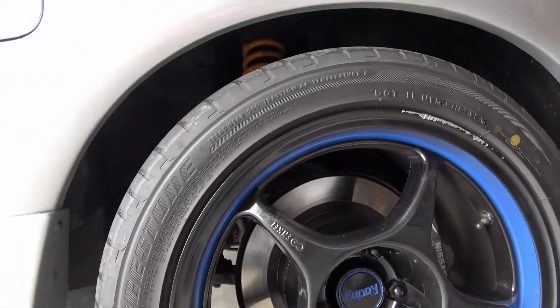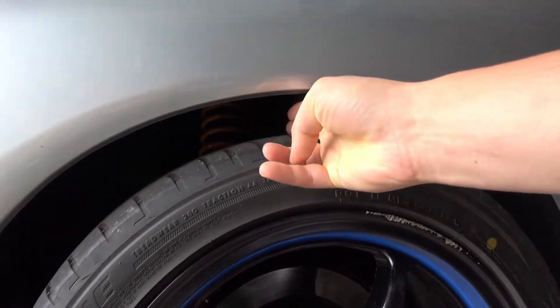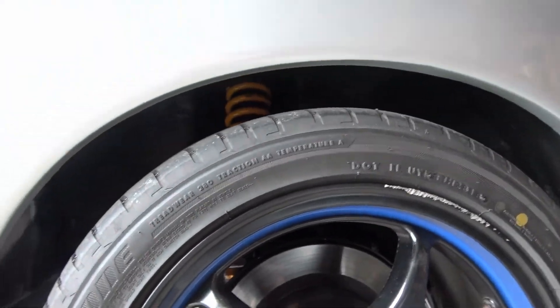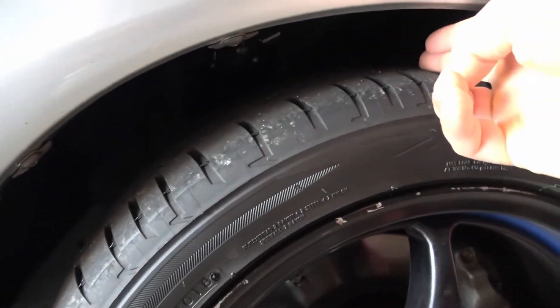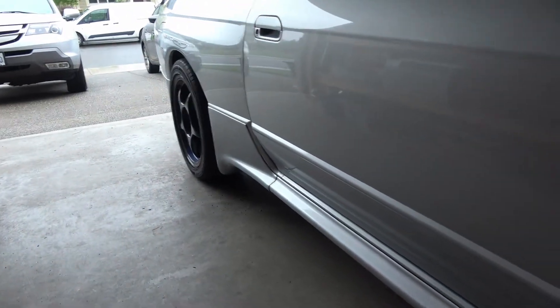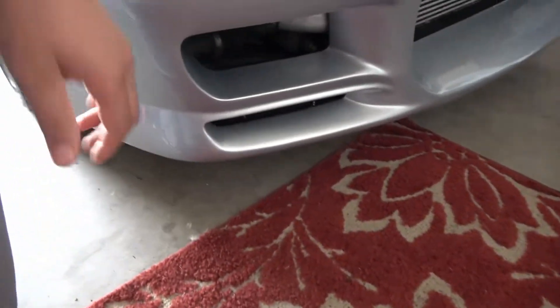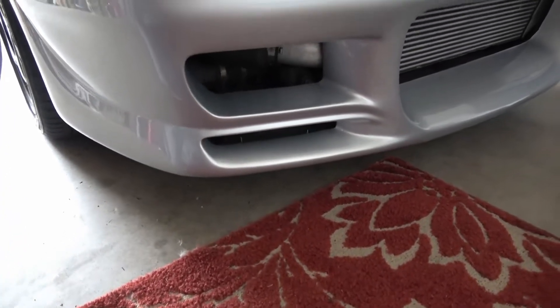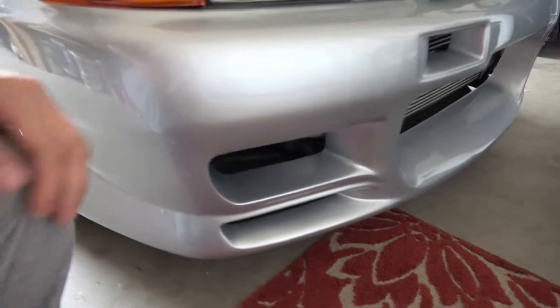She's all on the ground — that's the right height there. You've got about that much room of play, so I'm not going to have to worry about any rubbing off the bumps, which is nice. Front looks about the same amount of space. Some people might think it's a little high, but that's what Ohlins recommends. I kind of like a little higher ride heights because I don't want to rub. And with my Gretti front bumper, I don't want to scrape it going down curbs or over speed bumps — it's fiberglass, so I don't want to crack it and cost myself more money.